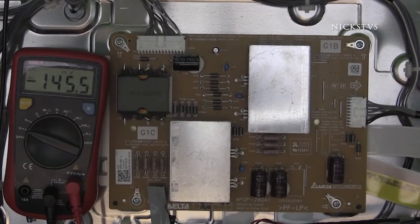In this video we're going to cover how to disable the error line for the backlight. We're using a 55X900C TV specifically, but this can be done with many Sony LED TVs — XBR models, KDL models, 1080p and 4K. The legitimate fix is replacing LED strips when you get a 4 or 6 blink error code, but this is a cheap, quick trick to avoid completely disassembling the TV and replacing those LEDs.